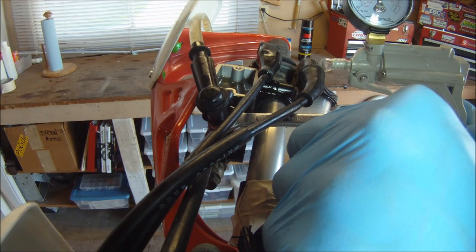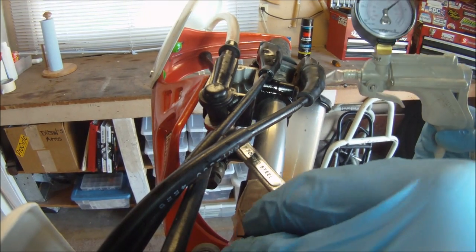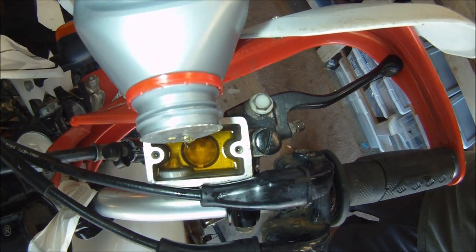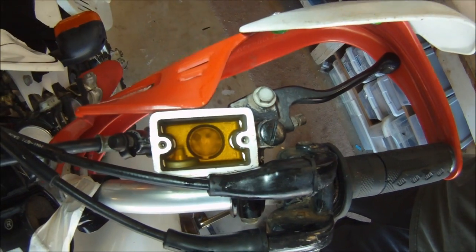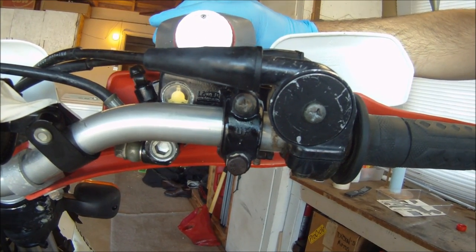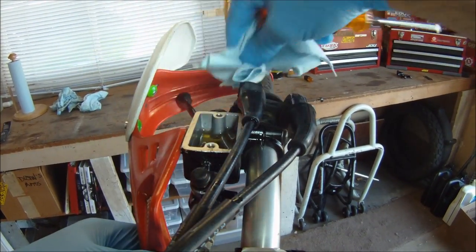We're going to create a vacuum again, open the valve, remove unwanted brake fluid, close the valve, and once again refill the reservoir. Eventually you'll see the fluid in the reservoir begin to look clean again. That's when you can top it off above the lower mark, and clean up the area real good — make sure there's no residual brake oil. Slippery brake levers are never a good thing.